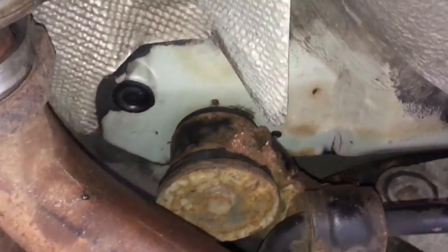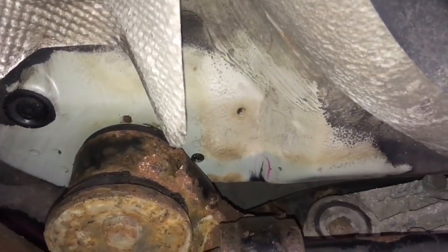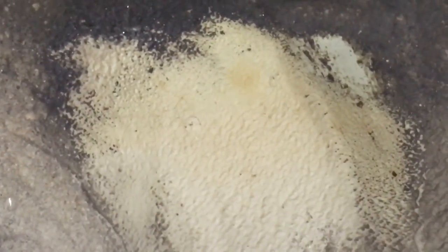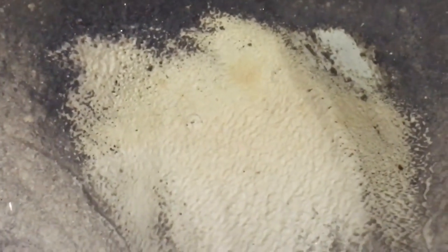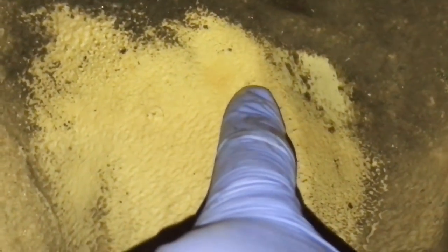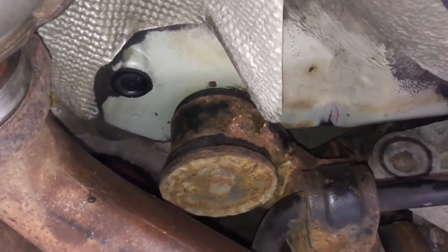So we know already we're going to need to look inside the car with a borescope camera. We've actually already done that and discovered a couple of cracks, so we'll show you those shortly. We've also cleaned another patch off here — these are the little bits that people don't realise how important they are. There's a small hairline crack forming around a spot weld here, which doesn't look much but is a typical sign of the rear axle carrier panel starting to move away from the chassis. There's also another one starting to crack on the left hand side of the chassis leg inside the car.